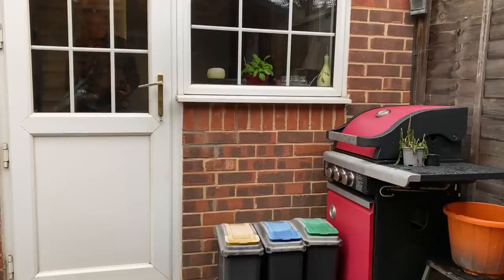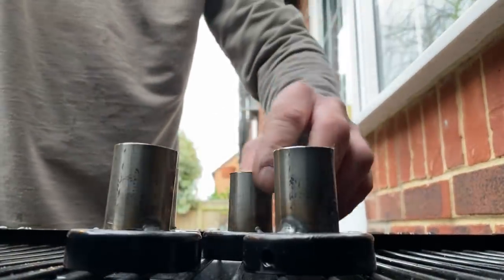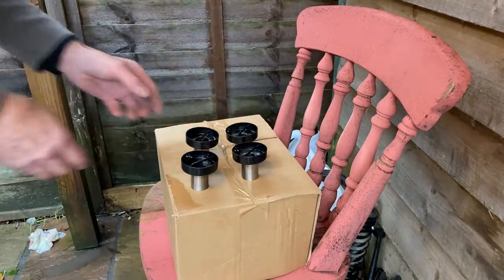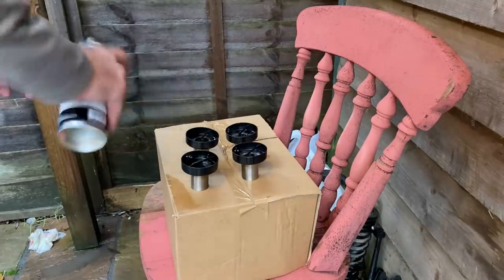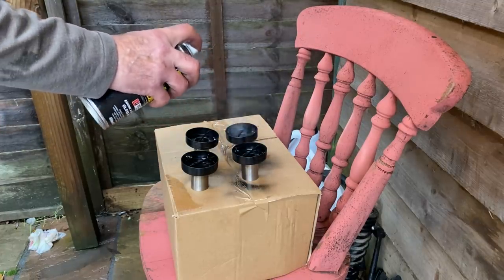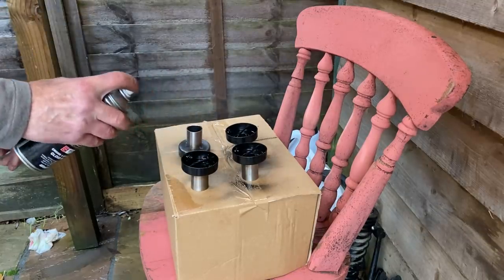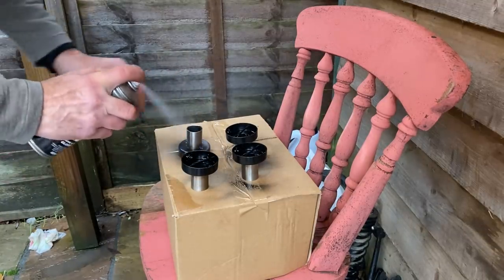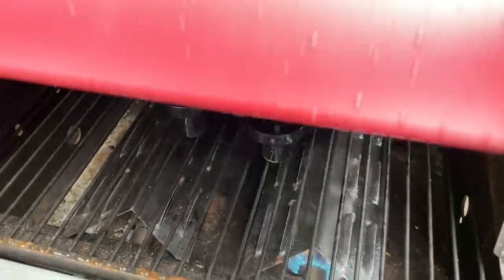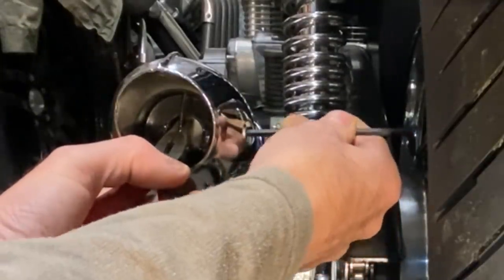The parts are now ready for painting, so I take them out into the garden and warm them up in my barbecue — it's brilliant for warming things up before painting. I use heat-resistant epoxy paint; it goes on really nice and you can bake it in the barbecue at about 150 degrees C for about half an hour and it goes glass hard. I return the baffles to the barbecue, shut the door and give them a good bake at 150°C. After they've cooled down they're all ready to put back in the exhausts and they look just perfect.